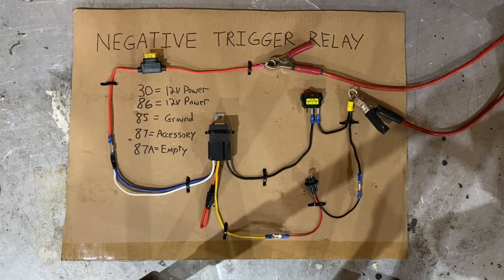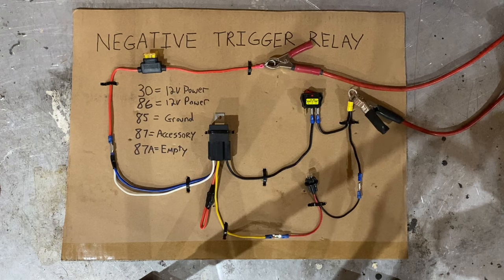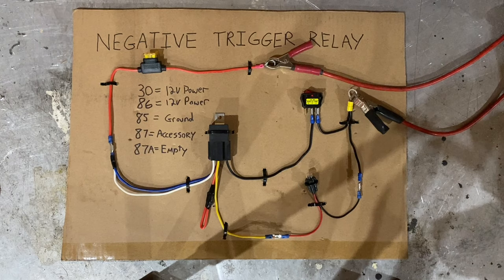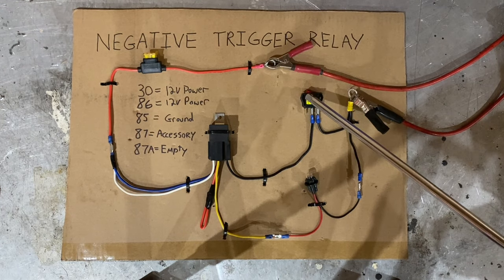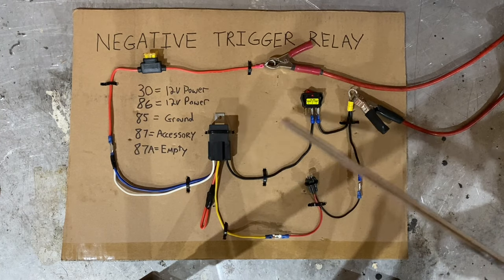What is a relay, and why do you need one? The purpose of a relay is to control a lot of electricity with a little tiny switch. If you were to run a lot of electricity through a switch, you would melt it, because a lot of switches are only meant for like five amps. But most accessories on a car are much more than that — a radiator fan might be 30 amps and a fuel pump might be 20 amps. So if you were to run all that power through a little tiny switch, you'd burn out the switch. A relay is actually meant to handle much more electricity, so the switch controls the relay and tells the electricity to turn on and off.